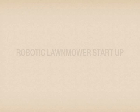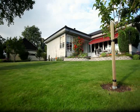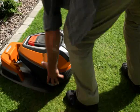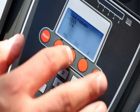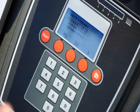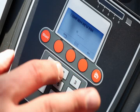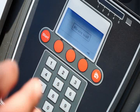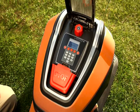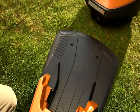Robotic lawn mower startup. Before starting your Flymo Robotic Lawn Mower 1200R, remove objects such as pinecones, children's toys, or smaller obstacles from the lawn. Turn the main switch on and place the mower in the charging station. Press the stop button and open the hatch — enter the pin code 1234 by default and follow the startup wizard. If you prefer, you can let your mower work with the standard factory settings, but we recommend making your personal choices according to the circumstances of your garden. Please read the Flymo manual for detailed menu information. At the beginning, set the cutting height to maximum — this will prevent the robotic lawn mower from cutting the wire. After a few days, you can start lowering the cutting height.